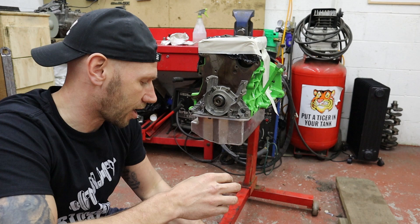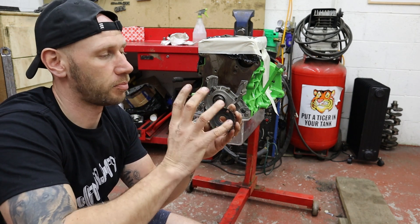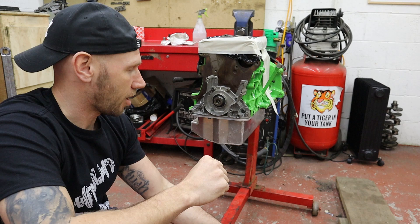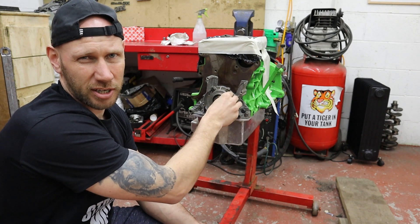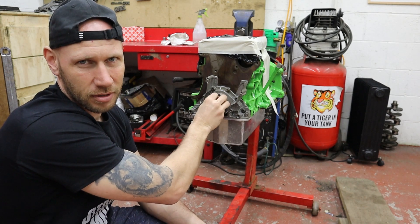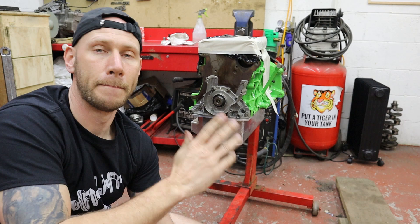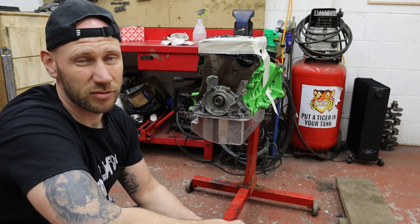On top of that, you can get a billet wheel — you can actually replace the full pulley with a billet piece, which means that little keyway is much stronger. Quite expensive though. Another option is the little Eka shims, like friction discs basically, which try to prohibit the crank pulley from moving and putting all the load onto that keyway. But there's a much simpler way that I'm going to do it, the way I've done it before — I'm going to dowel pin this crank.